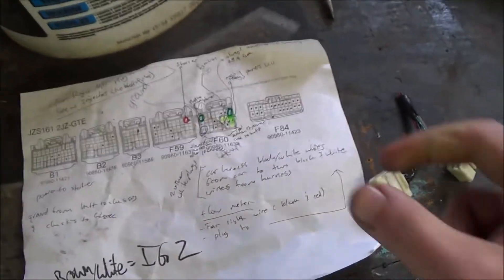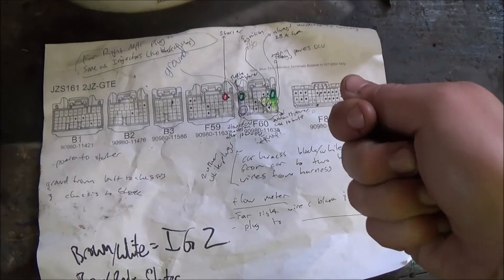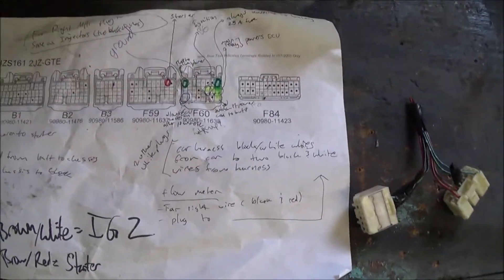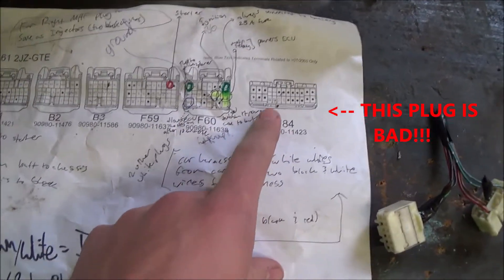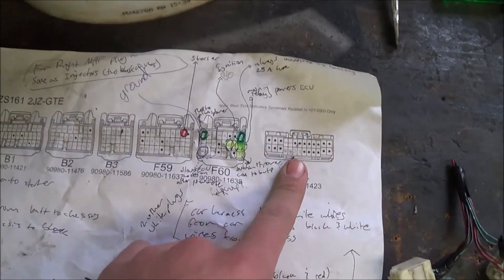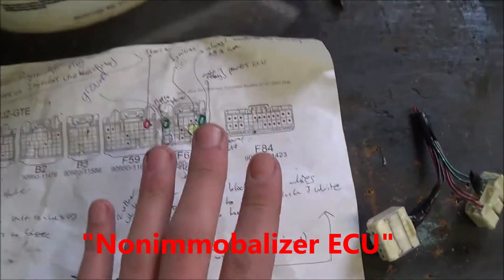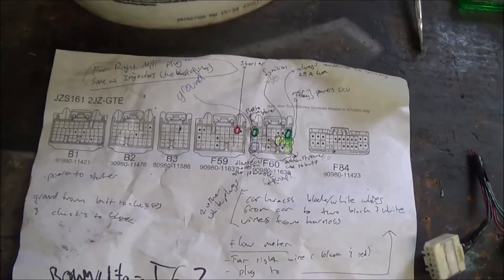If you ever have a key and it has that little black box on the end, it has a little signal in it so when you put the key in, it knows that it's that specific key for that specific car — someone can't make a knock-off and steal your car. Do not buy an ECU with that on it. If you buy it with that, your car will not start; it will just crank all day long but never turn over. So you're going to have to look for a non-immobilizer ECU. They're kind of rare, so if you could find one, even if it's a little bit spendy, it's probably best to just grab one.